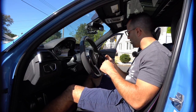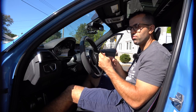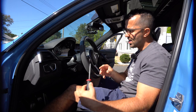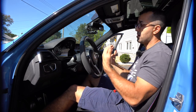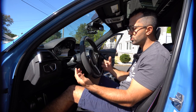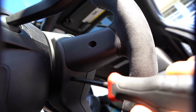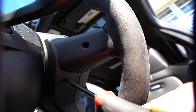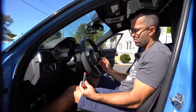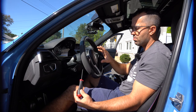Now what you have to do first — it's better to not grab a screwdriver but something sort of round. I'm using these Torx screwdriver tools. What you do is pop the steering wheel airbag, and in the back of the steering wheel you have some holes. Don't confuse the holes behind the buttons — you have to access the holes at roughly the 4 o'clock position. Angle the screwdriver until you feel the spring, push it, and the airbag will pop out.